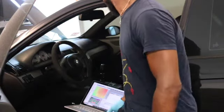Alright guys, so I just had a fuel leak. I was smelling gas and I wasn't supposed to be smelling no gas because I disconnected the injectors just to prime some oil through the system. I looked underneath the car, sure enough, by the fuel pressure regulator, there were two leaks by the front and the back, because if any of you watched that video before when I did the fuel pressure regulator, you'd see that there's probably about six connections on just the one setup. So I kind of knew in the back of my head that maybe one of them, and it ended up being two of them, did have a leak. I had to take out the lines, do a whole bunch of stuff, but back at it again, trying to see if I get some oil pressure.